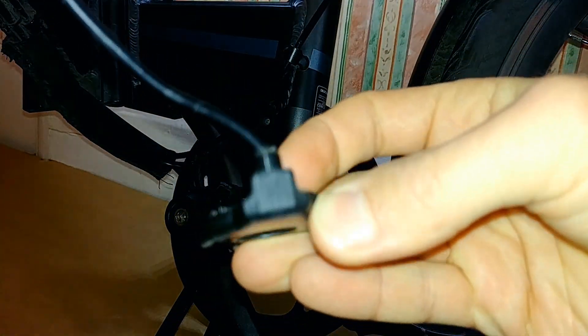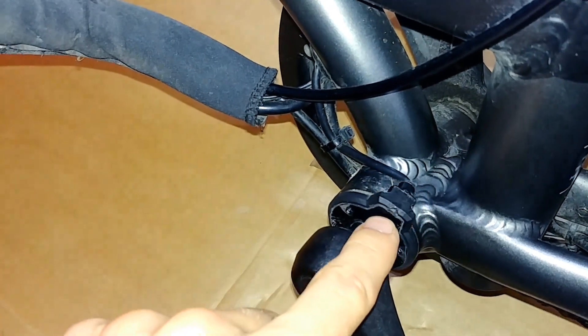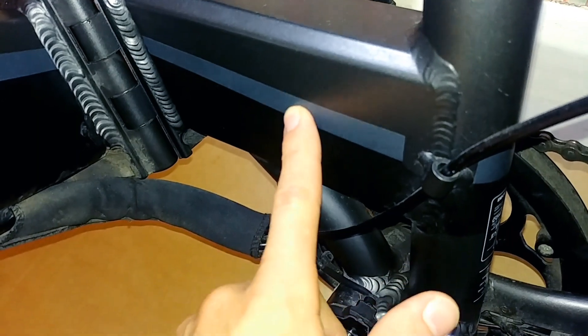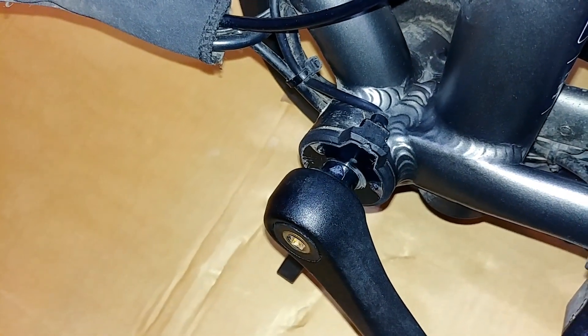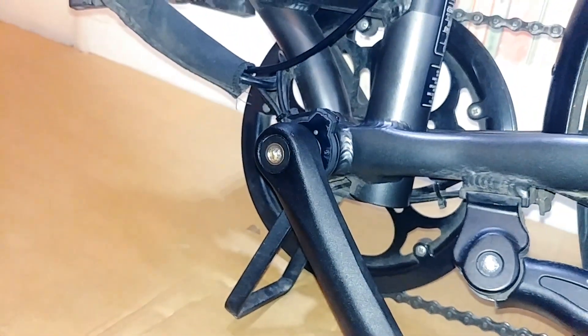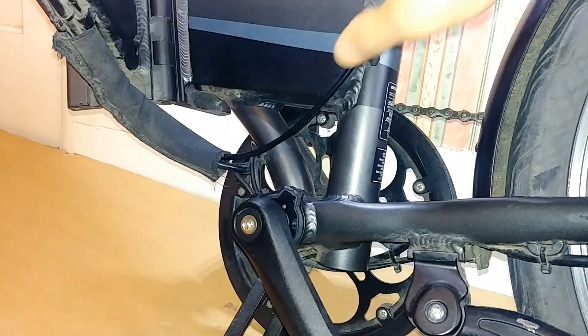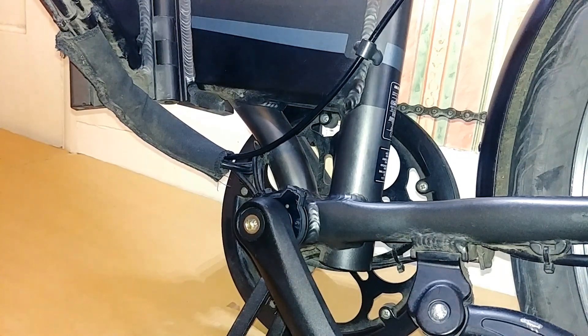So why did I have to replace it? As you can see in this design, the installed cable has this cable bent. The tube is in its way when you install it, and it goes up to the controller which is encapsulated inside the frame. Unfortunately this will always be bent and in time may develop problems. What happened to me was that it would intermittently cut the power from the motor. Luckily the issue turned out to be quite an easy fix.